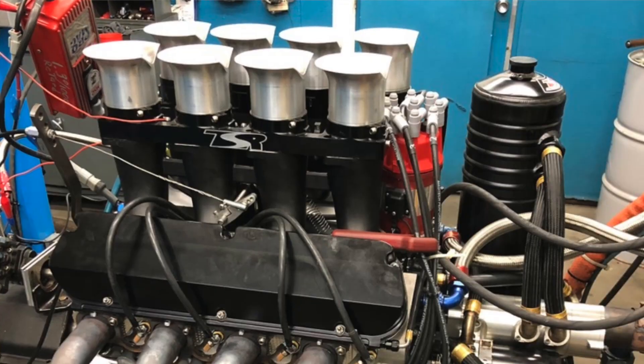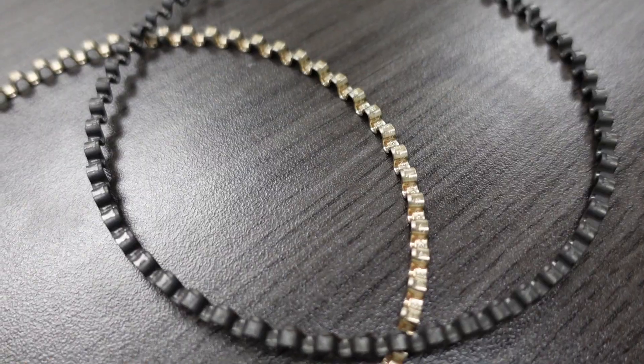We're talking about boosted engines and power adders, but let me jump back to the normally aspirated world. In comp eliminator, pro stocks, NHRA stockers, sprint cars — they want to get that oil ring as light as they can get it. How low can I go? The answer is always as low as you can without getting into oil migration. But here's the problem: let's say you've got an eight pound oil ring in that stocker or sprint car — she's dry as a bone. Then all of a sudden, hot dog wrapper, she's 260 degrees, and it just knocked four pounds out of that eight pound oil ring. You've got problems. By doing the nitrided expander, your eight pound oil ring stays at eight pounds. That's the key — it's the endurance it provides, which is why we call it the Endurance Ring — with an N, not an E, because it's nitrided. It gives you more tension retention and the endurance to withstand what happens to engines. Think of it as your oil ring insurance policy.